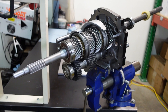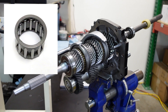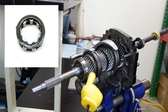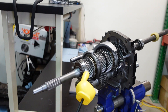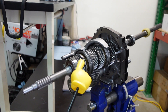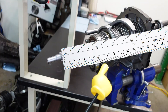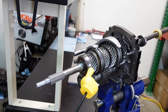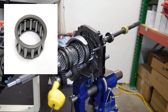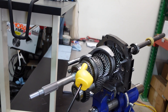This fourth gear set that AMP Gear sells takes a different style inner pocket bearing, so beware. The pocket bearing this transmission came with was the larger one. This fourth gear set is for two-wheel drive — you have to count the teeth to make sure you have the right one. Also, the S14 has thicker gear teeth than the S13. The new style input shaft takes the smaller pocket bearing, so if you ordered a rebuild kit you'll need to get the small pocket bearings separately.